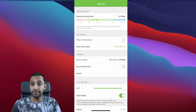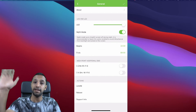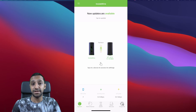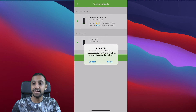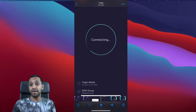For this video I'm using the wireless method since that's what most people would use. The mesh is working on the 5 GHz Wi-Fi 6 band. You can pause the mesh point, view About, add additional SSIDs from that mesh point to push the signal further, use Locate to flash the green LED, reboot, or view support info. The mesh point was running older firmware, so I went ahead and updated both the access point and the mesh point.